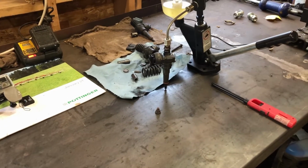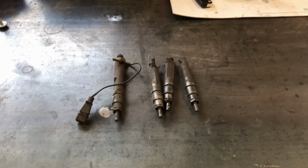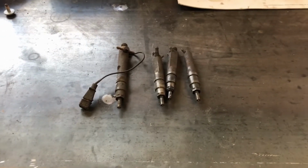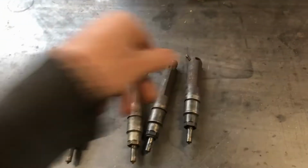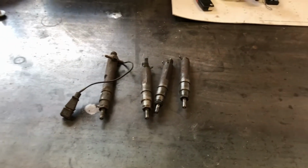That's just a little project there, but I decided to switch to these ALH ones because I'm going to need them before I need my PD injectors. So we're just doing a little video on swapping nozzles. Actually, I'm just going to swap this nozzle to a good body, and then I'm going to set the first stage and the second stage pressures.